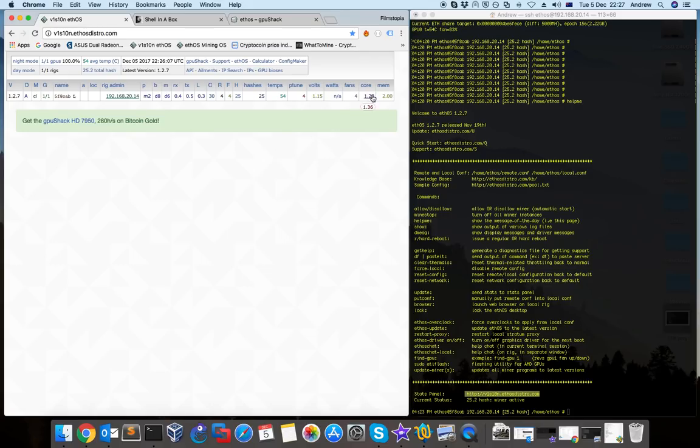That's why it's very important to find your correct power tune and your correct memory. You probably don't need to overclock the core, but you can overclock the memory for better performance. As you can see, 1.75 GHz is the default memory clock but I overclocked it to 2 GHz. The core remains at the default. You can also see information about the fans.